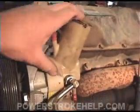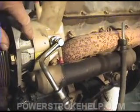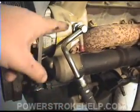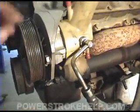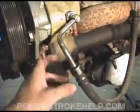The biggest design gripe I have is that the reservoir is slid onto the back of the pump. This particular one's been replaced recently, but this plastic piece will become loose on the metal piece. The plastic meets below the fluid line, so the fluid should be right up in here. There's just a big O-ring around the outside to hold the fluid in, and over time it will start to jiggle. There's lots of vibration in a diesel engine, and the heat will make the O-ring hard. As fast as you pour fluid in one end, it's going to pour out the other end.